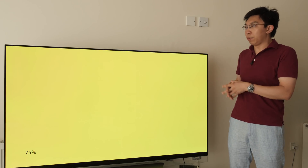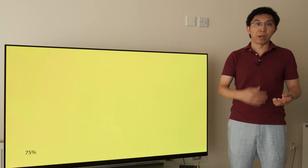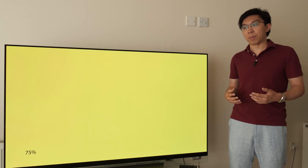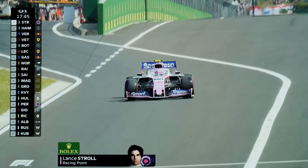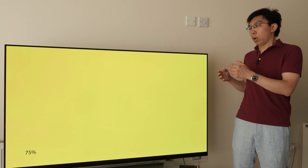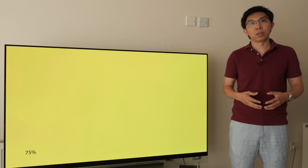But back to this LG E8, which has been running for more than six months, 20 hours a day, in 4-hourly blocks, switching between different channels — there has been no sign of permanent screen burn. I think it is very unlikely that you will develop any OLED burn-in on a 2018 or later set, as long as you vary your content and use it normally. It is extremely important to make sure that you power down your OLED TV using the remote control to put it into standby — don't just flick off a power switch or do a hard power down. You need to put these TVs into standby to make sure the compensation cycles run so they can clear up any image retention and prevent OLED screen burn.